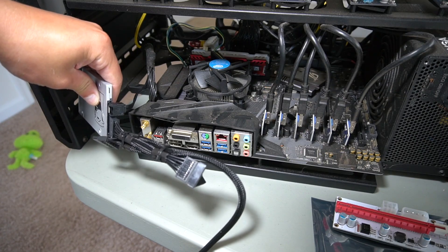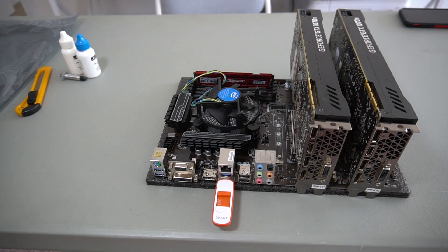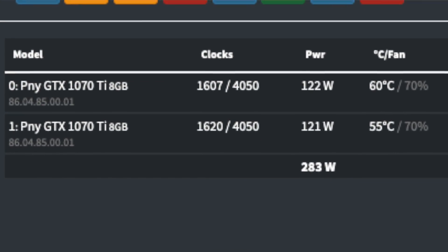Believe it or not, you're almost done. All you need is a hard drive, a power source, and a power button. For storage, you can use an HDD or SSD running Windows, or a USB stick with a Linux-based operating system. I recommend SimpleMiner SMOS - it has a graphical user interface so it's easy to use, and in my experience it's more stable. You download the latest version, flash it onto a USB stick, enter your email, then copy and paste config files for the coins you're mining.